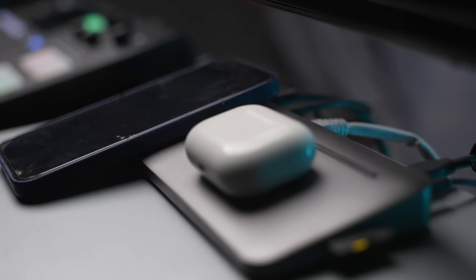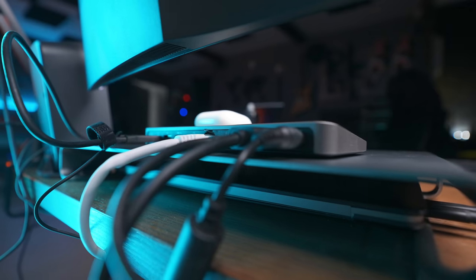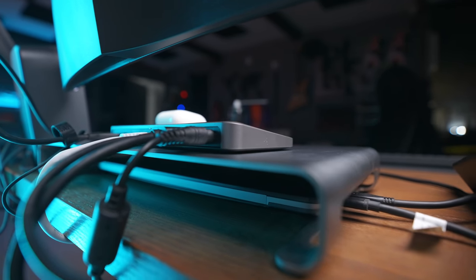It was really important to me not to plug multiple things directly into my computer, because I find it super annoying to constantly plug and unplug things. So I ordered the Plugable Thunderbolt dock so I can connect everything to that and then just one single USB-C cable goes into my computer. It's a fantastic device, but you have to make sure you have the right cables — for example you need a USB-C Thunderbolt 3 cable to send a display signal and get the highest speeds. It definitely streamlines the workflow and makes my laptop feel like a stationary desktop computer when I'm in the office.